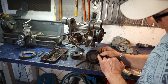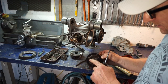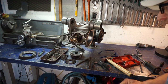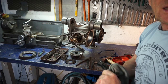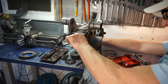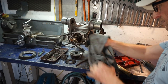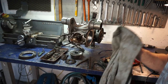That looks like it's been leaking some oil around the back of the gasket as well, because that's all wet. That's not good. Well, it was due a very good turn there. Thing is, this engine's been running thrashed to the limit and in really, really hot temperatures, like 40 degrees some days. So I was expecting a lot of wear and tear on this when it came apart. It gets so hot with expanding and contracting that you're going to get some oil leaks. It's just not normal the amount of heat we get here. Not normal at all.